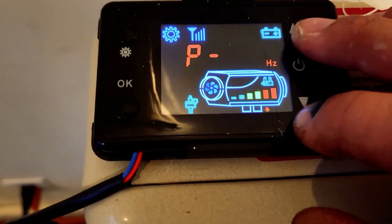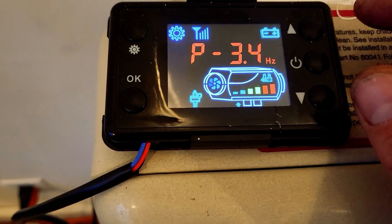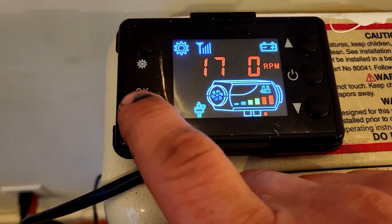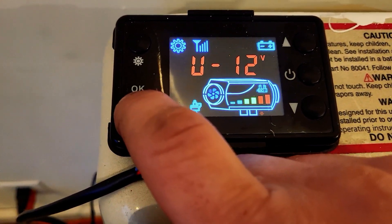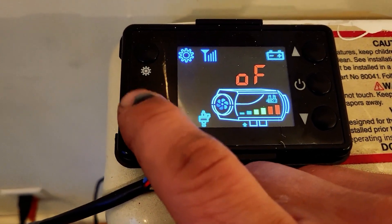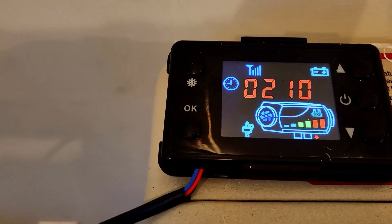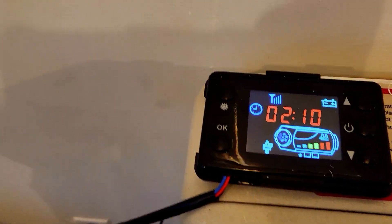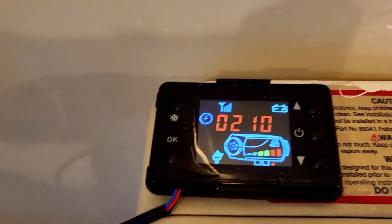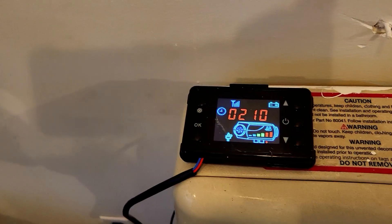In the settings: low mode is 1.1 Hz, high is 3.4 Hz. Low fan speed is 1,700 RPM, high fan speed is 4,500 RPM. 12-volt system, SN on 1, PF on 6 — that has been the best setup for me. It produces the most reliable heat. When I ran it with stock settings it smoked really badly on startup, and sometimes it would just keep smoking — which is also when the muffler caught on fire. With these settings it works great.